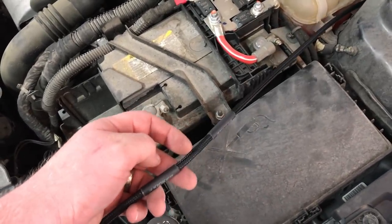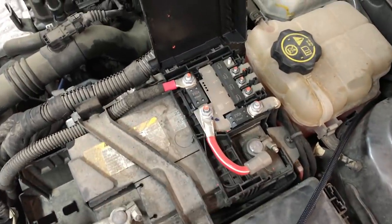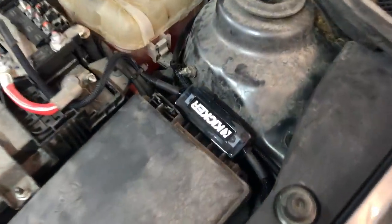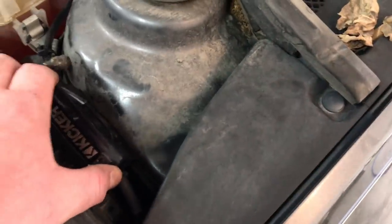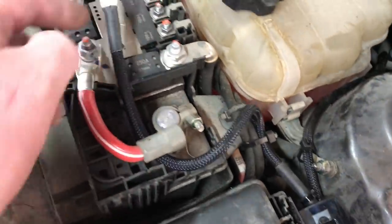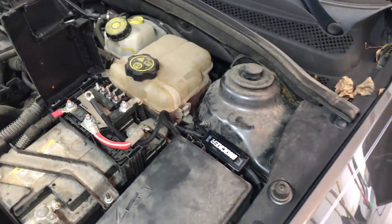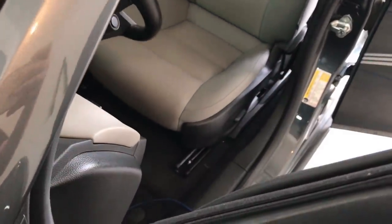We're going to put our inline fuse in this position and then work our wire up to connect to the stud on the fuse distribution block. We went ahead and got our fuse holder and fuse mounted — it's sitting right in this little pocket, all zip tied and nice and tight. We're going to go right to that stud once we're ready. At this point we're pretty much good to go under the hood, so let's start running our power wire along the driver's side kick panels all the way to the trunk.